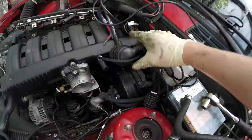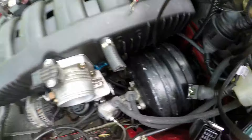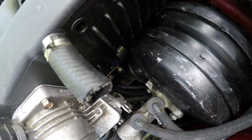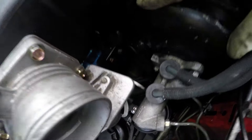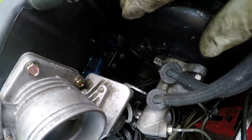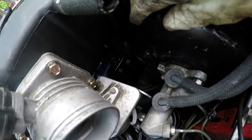I had to shave down some of the intake manifold fins, which is not my ideal situation, but I guess that'll work. We've also got an issue where the IX booster is precariously close to the OBD-2 to OBD-1 M50 intake manifold swap, so hopefully that'll fit — we'll find out.